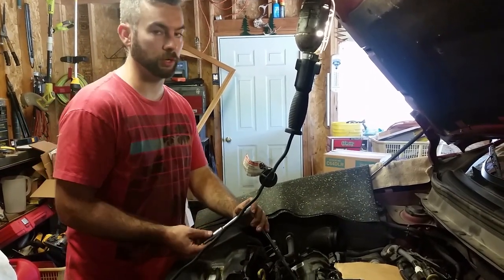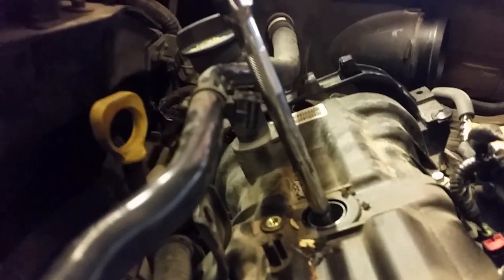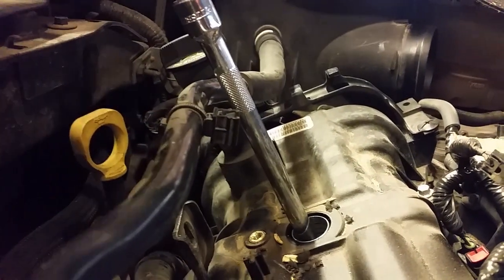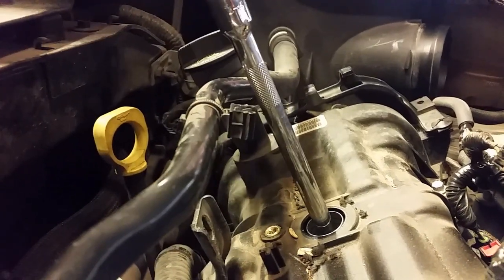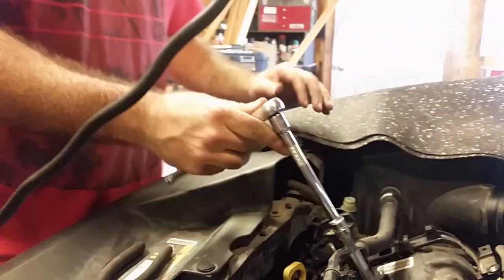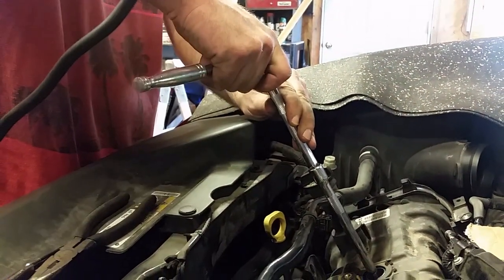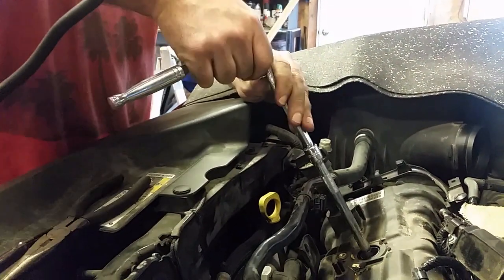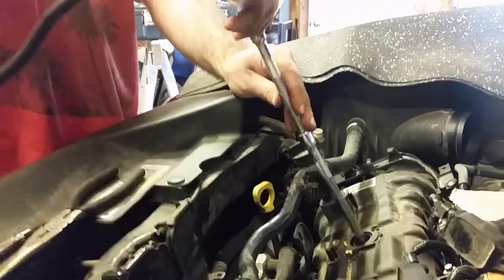This one, however, is doing what I was talking about. Now bring the camera close and listen in here, you'll hear what I'm talking about. Well, maybe you won't. You can kind of hear the threads, sounds real gritty. So what we'll do is we'll go out a half turn and back in. And out till you feel that resistance, see right there? And then we'll go back in. And every time you just go a smidge farther until, yep, see there, it's all.